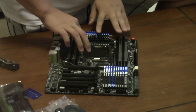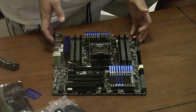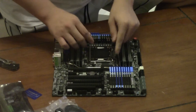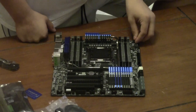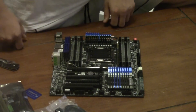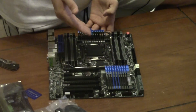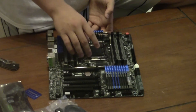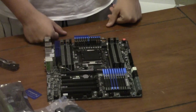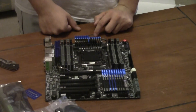Taking a look at the CPU socket with all those glorious pins — this does support Xeons because it uses the C606 server chip, so you can put in a Xeon 8-core if you want. Unfortunately you cannot overclock those, but if you use an Intel i7 consumer enthusiast-level chip, you can overclock, which is what I will be doing. Up here we've got the power delivery with dual-stacked MOSFETs that supply ridiculous power to the CPU. According to Tom Logan's video review, it actually has horrible voltage droop, which was something I had to sit and think about for a while. But in the end I got this board because I want these SAS ports really bad, and I don't overclock tremendously, so that's not going to be a huge deal for me.